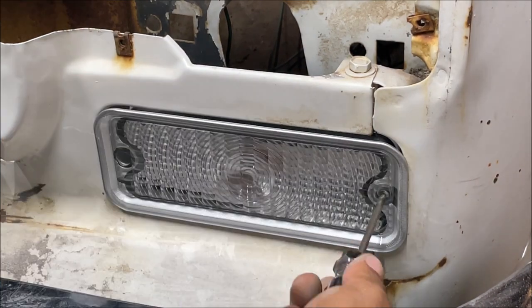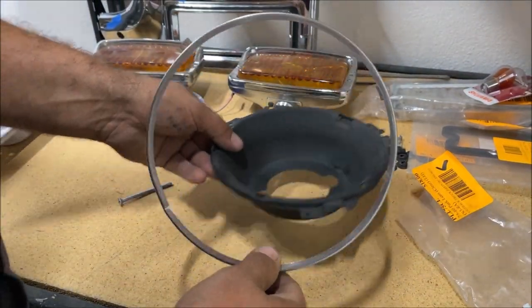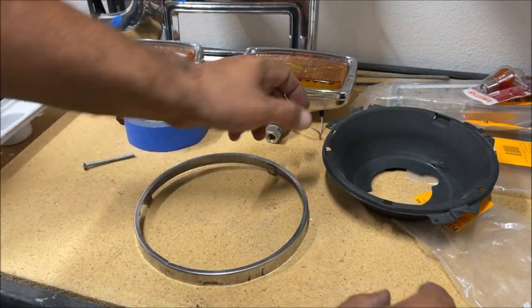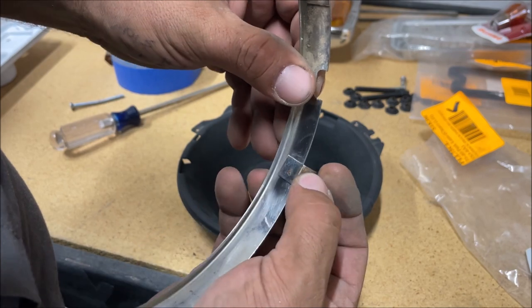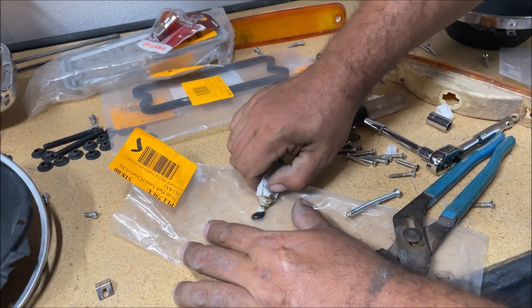The gasket was four dollars — but for four dollars you could have bought a tube of caulking and done the whole truck. We've reached our first little headache: when I was cleaning this trim ring a tab broke off. Don't worry about it, we can fix it. It just has some tiny little spot weld on it. We just need to get some JB Weld, stick it, and then line it up — mix equal parts.